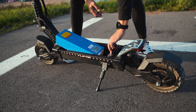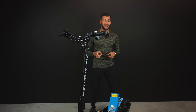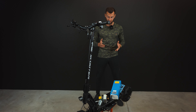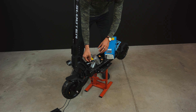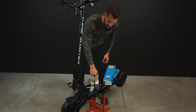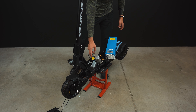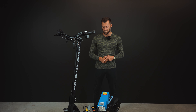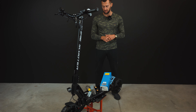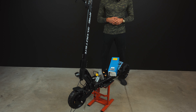On this one, the controllers are really compact. It's not mentioned on the product page, but for this price point, we didn't expect this scooter to have sine wave controllers. We confirmed with Yumi and they said those are sine wave controllers — it's a 28 amp controller, two of them. Sine wave controllers provide you with more range and a really smooth acceleration curve, and of course those controllers are more expensive than the regular ones.